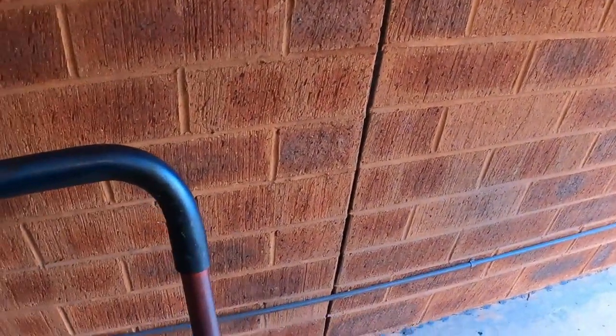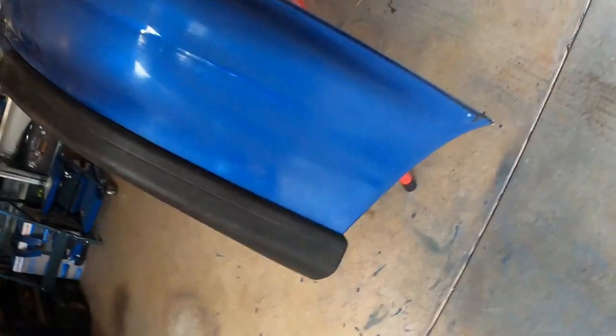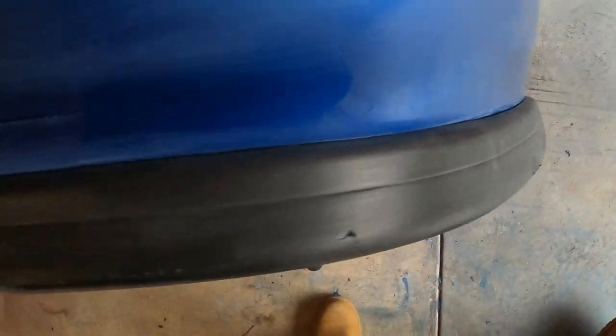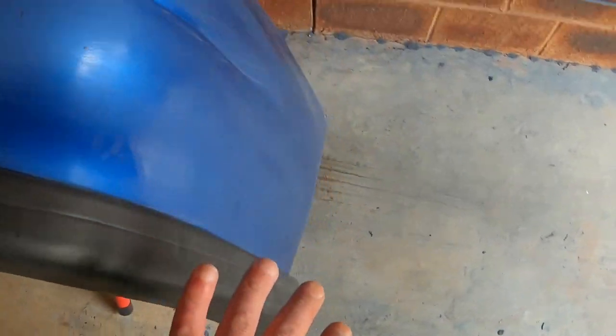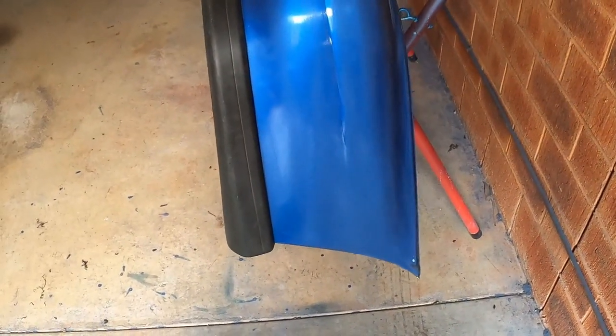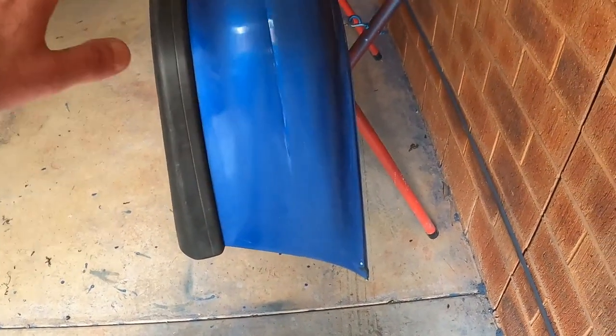Let me flip it over so you can actually see what I'm talking about. So this is the rear bumper and this is the actual lip — properly installed and it's not going anywhere. It's fixed, it's tight. On both sides. This is now becoming a bit more WRX than a normal Impreza. Because it's black, I'm planning to paint it so all of it will have a matching color that will accentuate the rear bumper. That was an easy fix. Now all I need to do is a quick sand to ensure the area is properly sanded and clean, then wax and grease remove, and it should be ready for the first coat of paint.